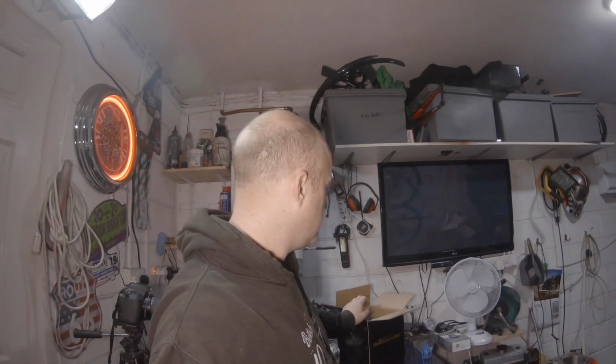I'm not going to use those conrods. Those conrods will bend very easily with a big turbo like that blowing at it. So I've got to order some H-beam conrods. I'm probably going to get them from Classic Swede.